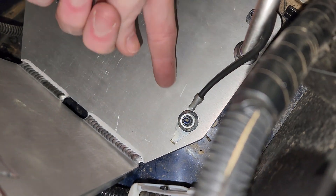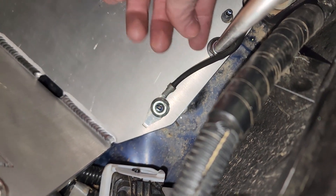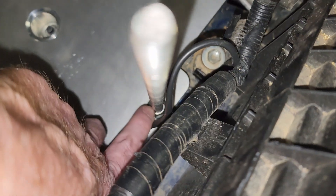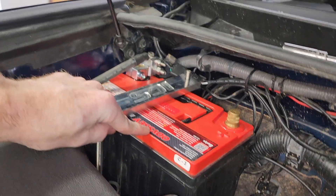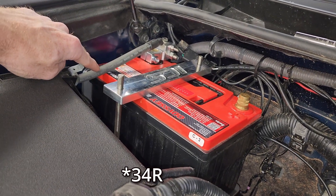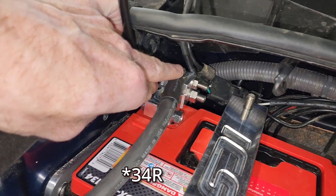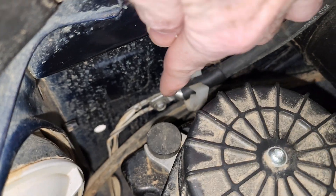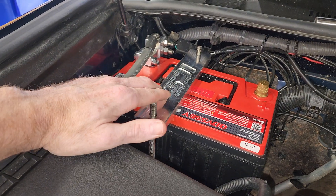Right before we put the battery in — this ground cable was underneath the tray. You can see it goes to the harness. We went ahead and used the stud from the 4Runner and put a spare nut on there. If you can get it to fit under the tray, go for it — I couldn't, but that's what I did with the ground cable. Maybe put a little bit of protection around the studs so it doesn't rub. I've got the Odyssey battery in — remember Group 34 is as big as you can go; I'd check to see if you can get a 34F. I tightened the ground cable from ICS down to the terminal and ran it all the way up next to the secondary air pump to keep it away from the fender.